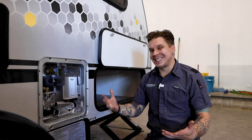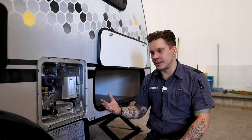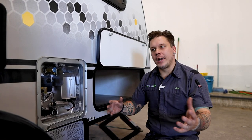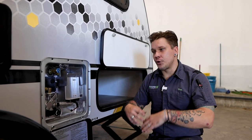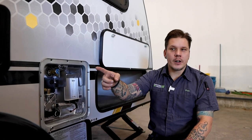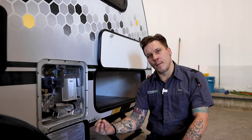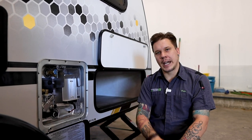You should be draining this water heater anytime the unit is going to be in storage for more than 7 days. So kind of to bring that whole purging scenario full circle, so we can drain the unit 100% of the water, if the freshwater tank has been in use, we're going to reach on the underside and we are going to remove that cap on the bottom of the freshwater holding tank. That's going to drain, of course, from that location.